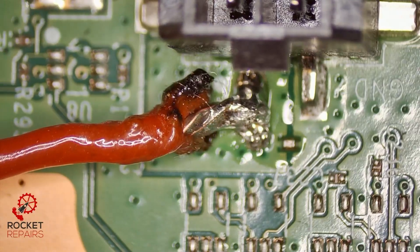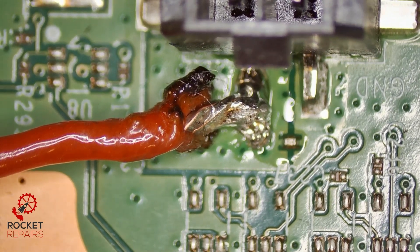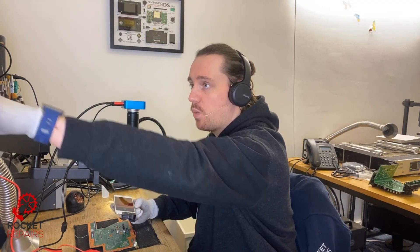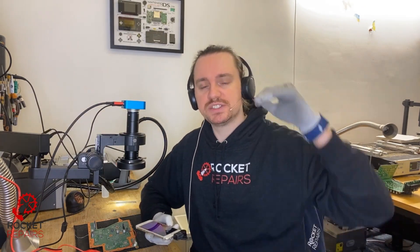What I've done already is hooked a wire up and we're going to inject some voltage to see if we can locate where the short is. I'm not sure if the equipment we're using is going to be good enough to show you where the short is, but I'm going to inject one volt with three amps. Even though it's a 12 volt line, we want to start at the lowest voltage we possibly can and then scale up if need be.